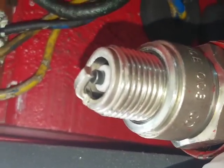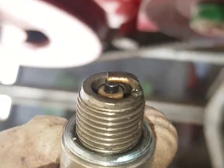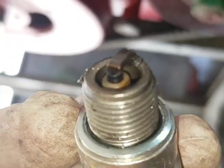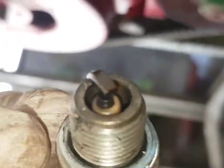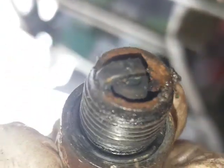Because it's a brand new spark plug, you've got a nice clean white ceramic. If you look at a plug which has been run a while it'll have a brown colour — not a bad plug, but you probably won't get a little blue spark; you'll get a brighter white spark when the plug's being used. Less about spark plugs — they can be troublesome. This one I've thrown away came out of this engine; it's an NGK B6. Look at the state of that — the insulator is absolutely filthy and it's obviously had a lot of corrosion. Don't waste money on old plugs; NGKs particularly I don't like.